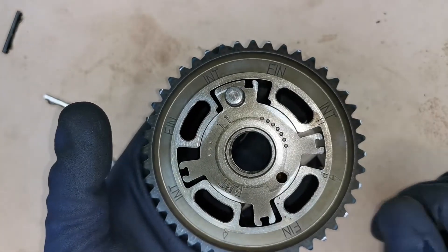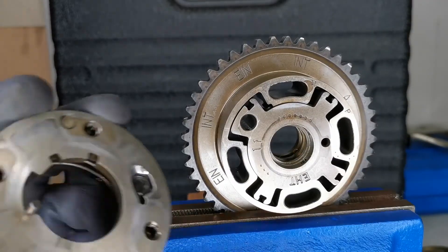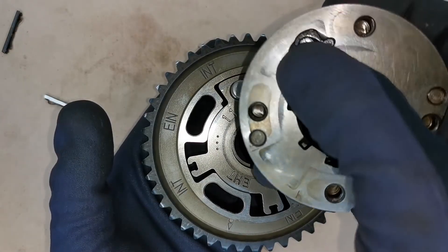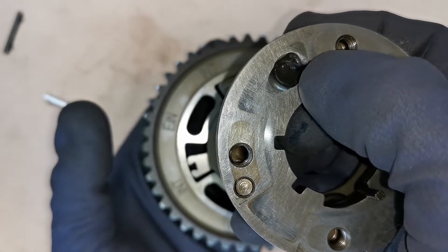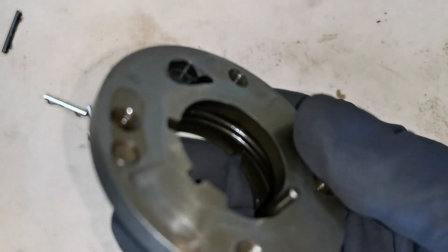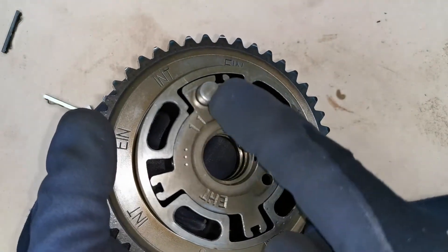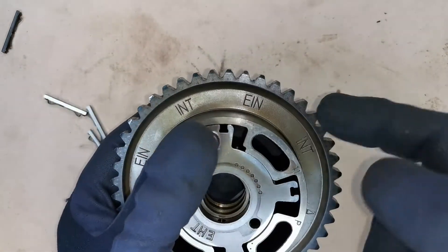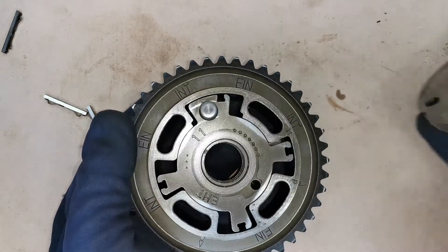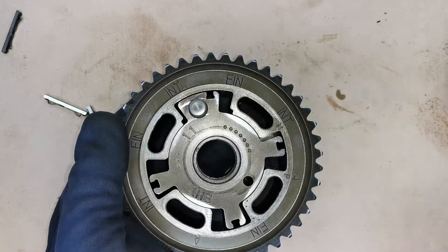The failure of this item was caused by wear on the top of this locking pin in conjunction with the plate. There is wear on the plate — it's got an elongated hole, and also on the opposite edge the side folds in. So you have wear on two parts of the plate, and you also have a countersunk or chamfered edge on the locking pin — basically a rounded edge which causes it to easily slide out of the locking position. That torsion spring sits in there and locks on the front plate.